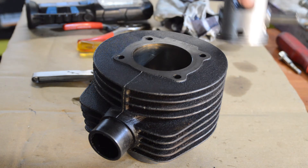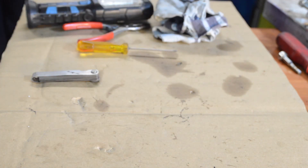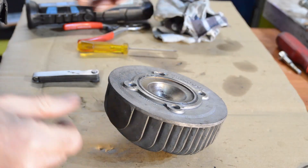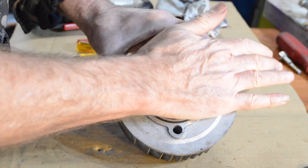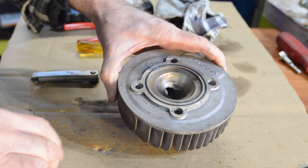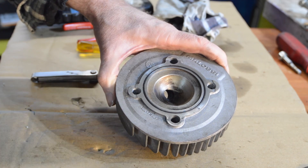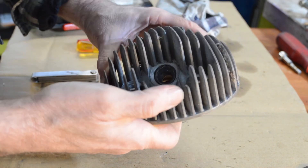The rings are good, the gap's good, the piston's good, the barrel's good. I will give it a very light hone before I re-fit the rings. The final thing for this video — just check the head. Small amount of carbon in there, not a lot — I'll clean that out. The rubber O-ring is fine, there's no sign of any distress. I will not be doing the squish, because now I know it's not being ported and the intake's not being done — frankly it's not worth the effort as it's going to be in a very low state of tune.